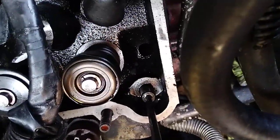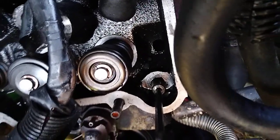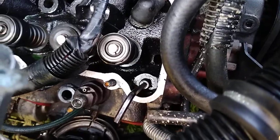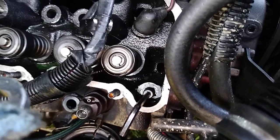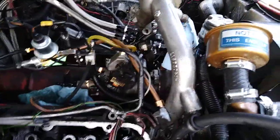Driver's side head is off and passenger side is still on. I've got one stud here in the corner — it got stripped out. I don't know why they put Allens on studs; why wouldn't they put a socket thing on the end of that? Stupid. So that one stud's preventing me from getting this head off, so until I can get that out I'll just continue on with the other side.